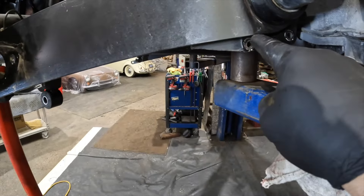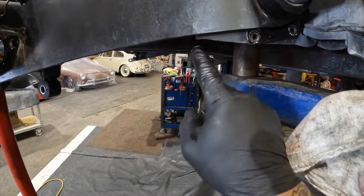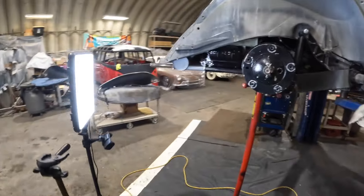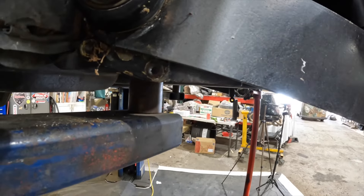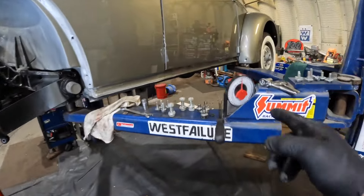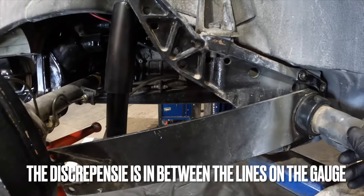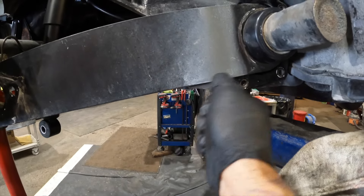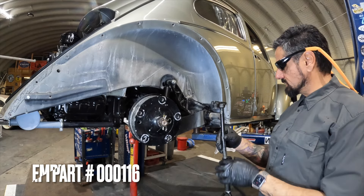We adjusted these and looking at this angle right here, there's like an eighth to a quarter inch of that perch that still shows there. Going over to the other side, we have almost an identical reveal on both. I'm pretty stoked on that. We are going to put this back together and see how it sits. We're actually showing one more degree on this side than the other, but that could just be an imbalance in the car itself — what I'm really looking at is that angle going on down there.